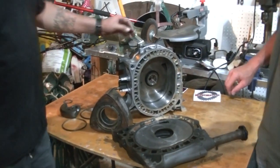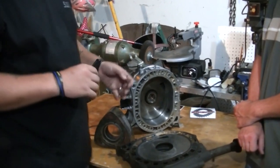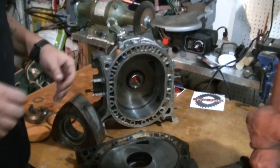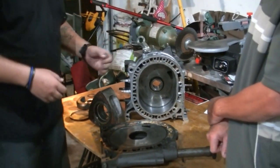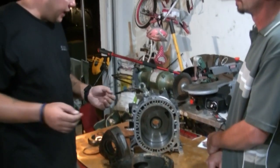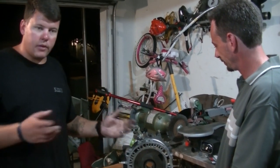Yes, definitely. Altering the size and the shape of the ports, as anybody knows, with a cam swap, with porting and polishing valves or heads, so to speak, changing your valves, going bigger or smaller valves, valve travel, and so forth, this is the same concept. So going to a bigger exhaust port, naturally you can get more out more efficiently. Going to a bigger intake port, we have several different ports.